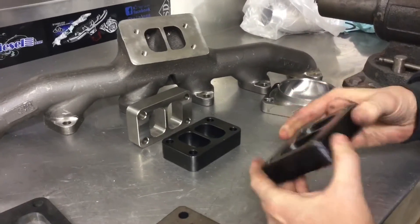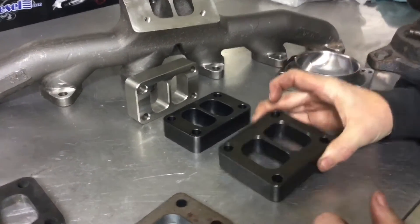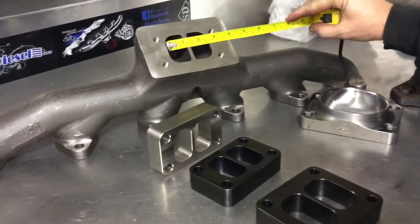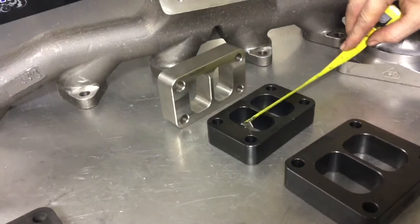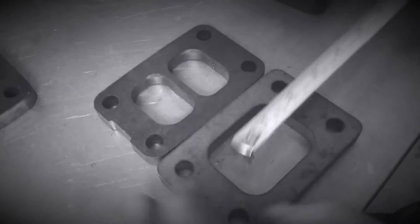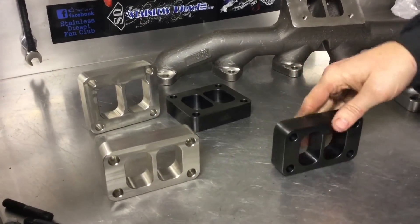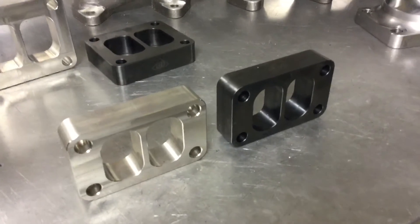What we've got here are our CNC'd, very concentric flanges. They'll hold any gasket down near any temperature. So they don't warp, they don't move, they stay. When we get to some sizes here — our gasket matched T3 flange size, you can see that it's about 2.5 inches across. So our CNC spacers match exactly. On some of the oddball stuff, there's quite a bit of area blocked off — I guess we got 2 and 3/8 inches there. And here we have our CNC'd T3 flange, it's 1 inch thick, gasket matched to our manifold and the large style T3 gasket.